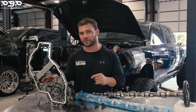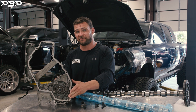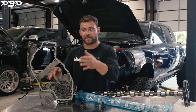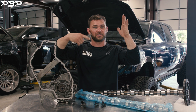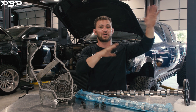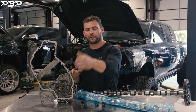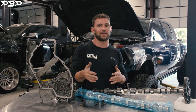You've got to make sure it's a high-speed unit. We've now got an advantage over the truck — high-speed — because it's going to be overdriven. This is a smaller gear, so now we're going to take the capabilities of a 12-millimeter pump that usually spins at one speed and spin it faster. We've got a ton of fuel to use for this build. Just keep in mind: when you swap this front cover and go to this small gear, make sure your CP3 pump is adequate for the speed that it will be doing.